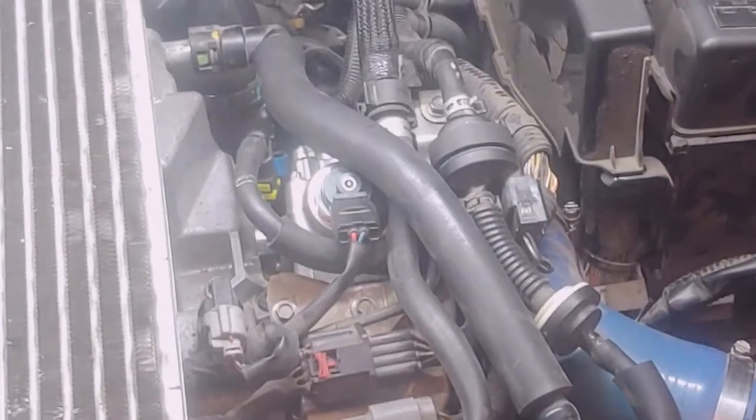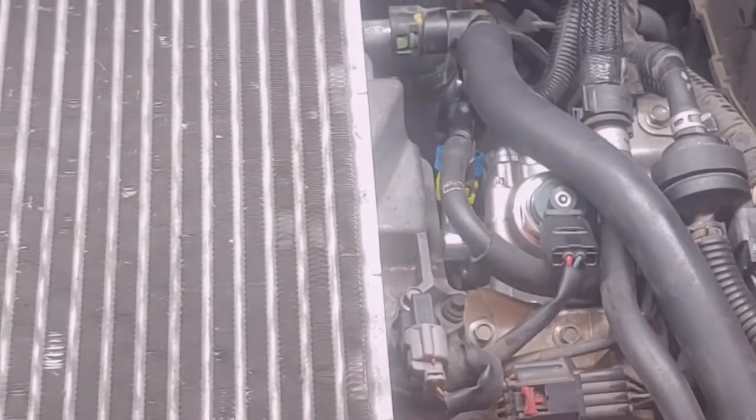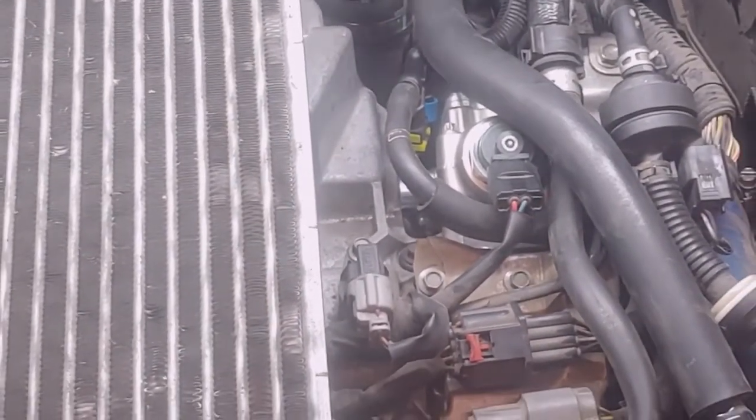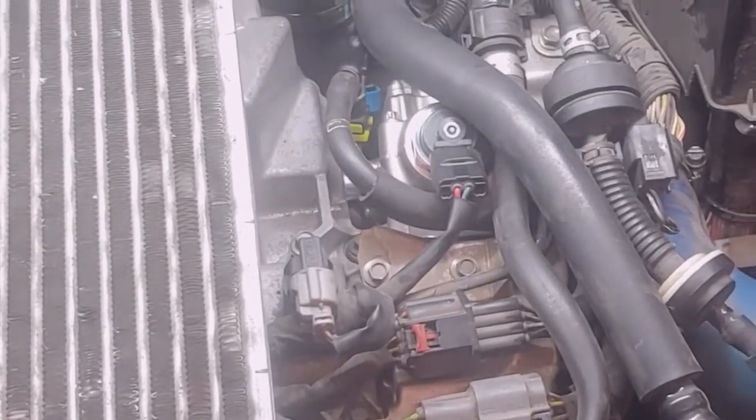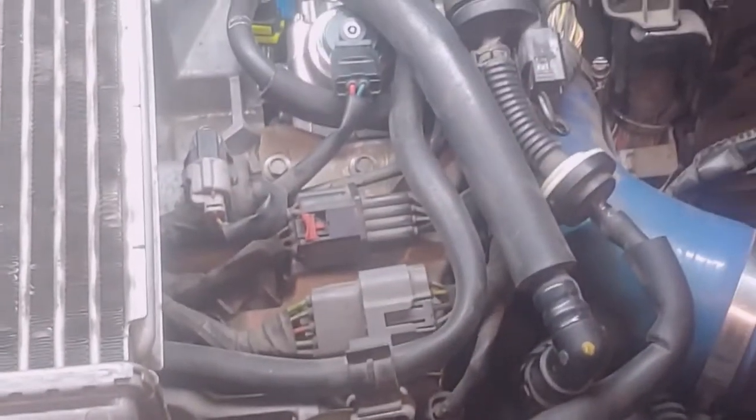All right, so hopefully you guys get the small gist of actually switching out your high pressure fuel pump. It is not difficult at all. You need very few tools. I think I used a couple of pry picks, a 19 mil, a 10 mil to take that off, a reverse Torx number 8 to take that guy off, and then two number 8s to take off that linked up fuse. But all we have to do is put these two bolts back in, put the cover back on, and we're done with this.